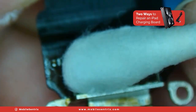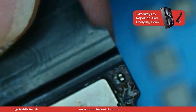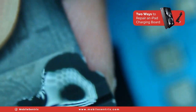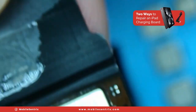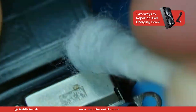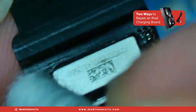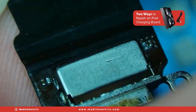Cool it down with some isopropyl alcohol and clean it up with a Q-tip. Now some of you might be wondering why take so much time? Well, the amount of time it took me to do this was less, most likely, than replacing the whole flex cable — because of having to remove this board from the frame with all the components you'd have to disconnect and reconnect. In this case it made more sense to just fix the issue, which was the corrosion, and double-check that everything was good. I removed the port from the flex just to be sure — I didn't want to plug it in with it potentially still shorted out.